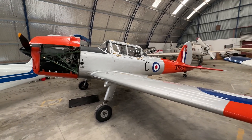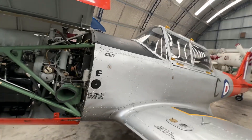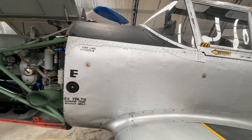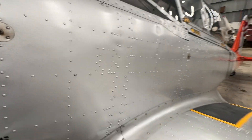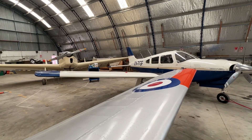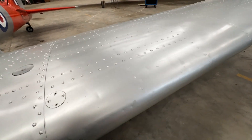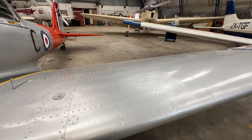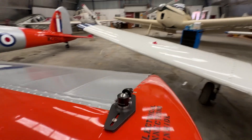The Chipmunk is largely constructed of varying gauges of aluminium alloy. If we look at the fuselage from about there — that's the firewall — all the way down to where the orange paint finishes, the whole thing is made up of aluminium frames and skin. If you look closely you can see where the skin is riveted onto the frames. Compared to a modern aeroplane like the Piper Arrow over there, the Chipmunk is made of really quite heavy gauge aluminium. You can see a couple of tiny dents and dings from 70-plus years of life, but none of the dimpling and oil-canning effect you see on a more modern aeroplane.